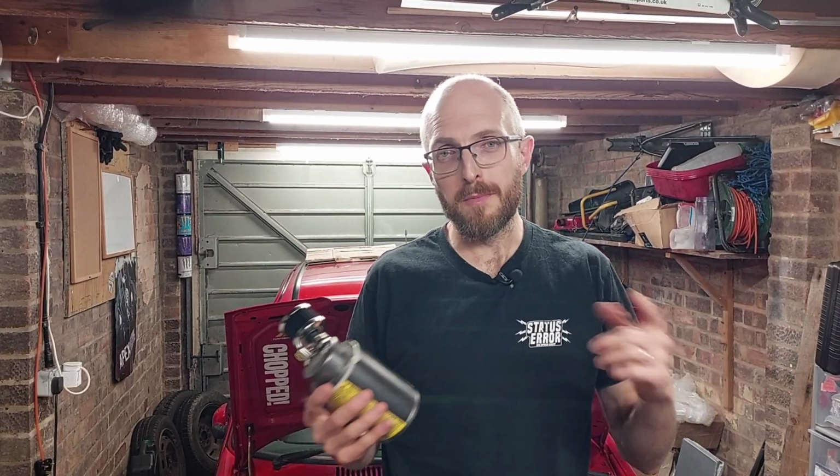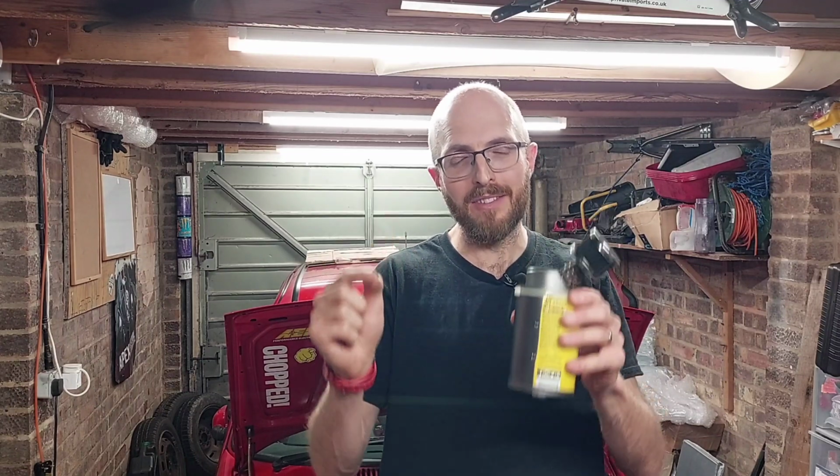Right, so that's all done, but it's probably worth explaining to you, for anybody out there who doesn't actually realise this, and I will explain both, one, what the breather system's for, and two, why you would need a bigger can like this compared to the one I had before. So, the breather system on your car very much is just to relieve pressure within your engine. As your engine pistons are going up and down and compressing that air, even in the most precise engine in the world, some of that air is going to get past the pistons and in the bottom of your engine, and it's going to build up pressure.